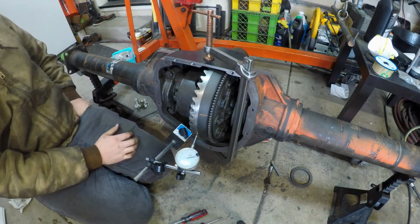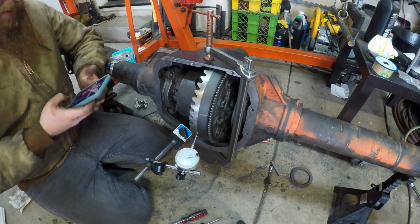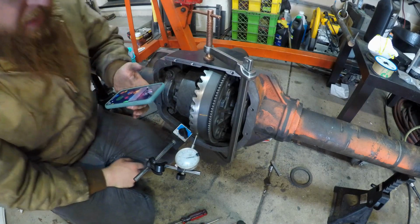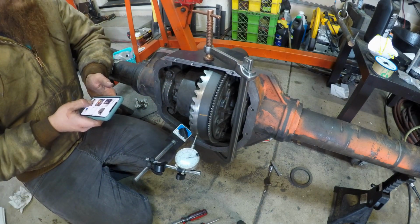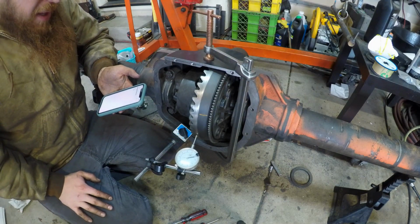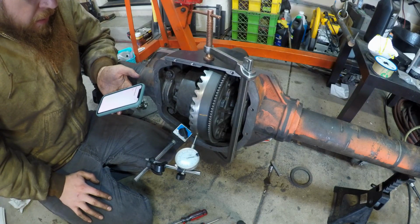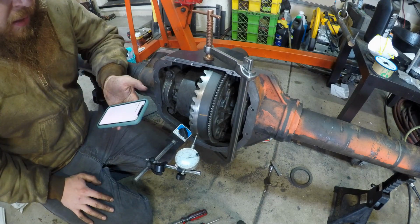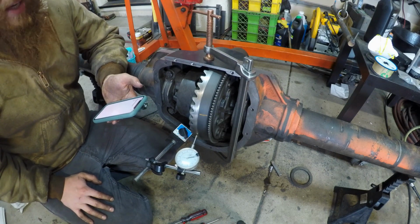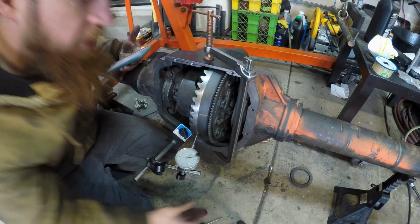The guys at work measured this ring gear with 12 thou run out, and with my dial indicator on this carrier, I am measuring 6 thou. So I guess it could add up to a total of 12 thou over. The smallest they measured it at was 10.123, and the highest they measured it at was 10.136. Now that I've got my highs and lows, I need to measure with the feeler gauges, and that will complete the knowledge portion.